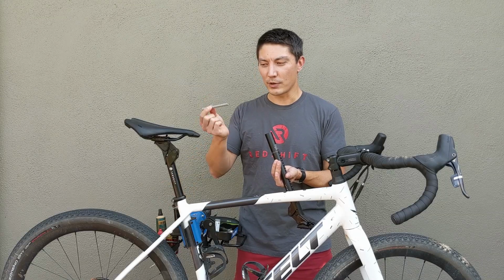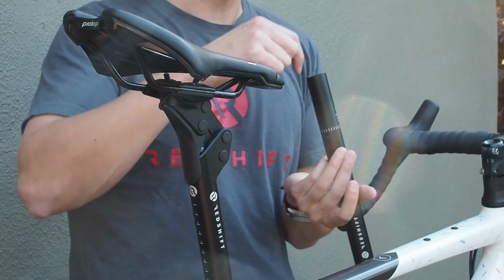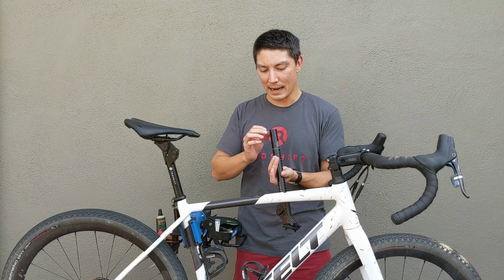And then if you need the inner spring, you can take the inner spring, drop it in, give it a little shake and make sure that it's gone fully down inside the outer spring. You're going to reinstall the second black end cap.